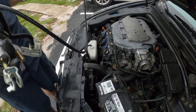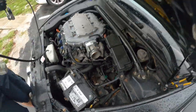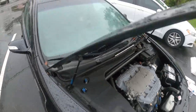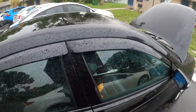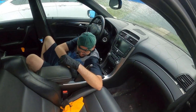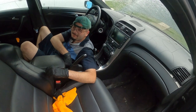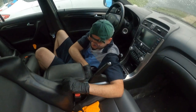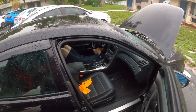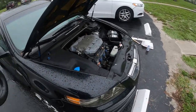The slave is over there — I ran it going underneath those hoses and then right into there. As long as it's going underneath that, we're good. Everything on the outside is installed: slave's in, master's over there, the reservoir is back up. Matt is now inside the car to put the two bolts on. The steering wheel — I knocked myself out a couple times on it — so Matt's now gonna put everything back together. After that, we do the bleeding process, and hopefully I get my clutch pedal back.